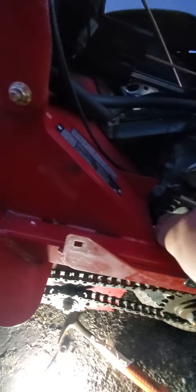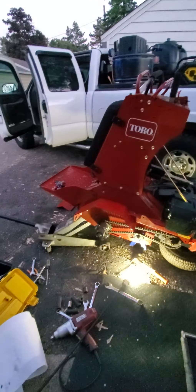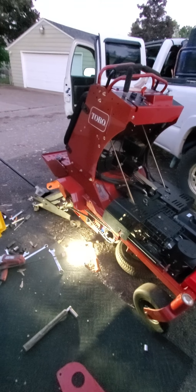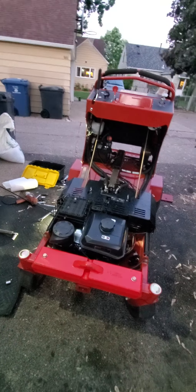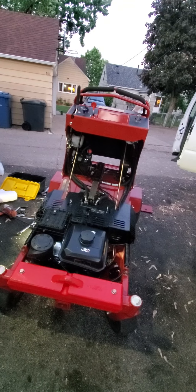This one is tight. This other one — it's a little loose, going about a quarter inch. Eventually it's going to get loose, so now just put the tire back on. Let it sit for a while because the oil looks a little off — let it sit, start it, and everything should start perfectly. So I've taught you how to fix the sprocket tensioner gear for the stand-on aerator Toro or X-Mark 24 to 30 inches. We found where the fuse is, and hopefully that works for you. The only problems I've found are the fuse location and the tine chain sprocket tensioning. Thank you for watching my video — I hope all of this can work for you guys.